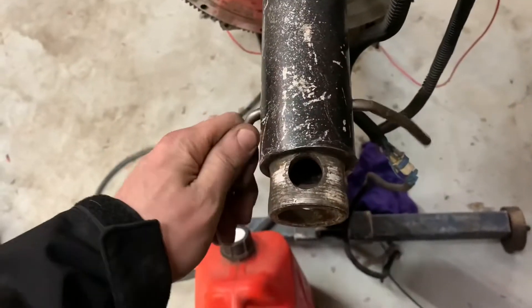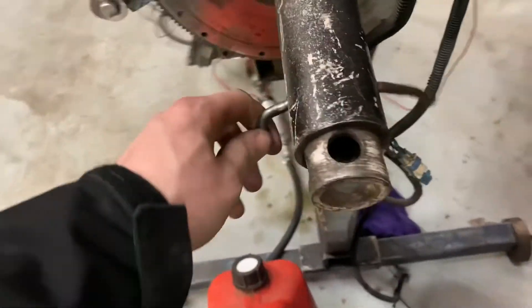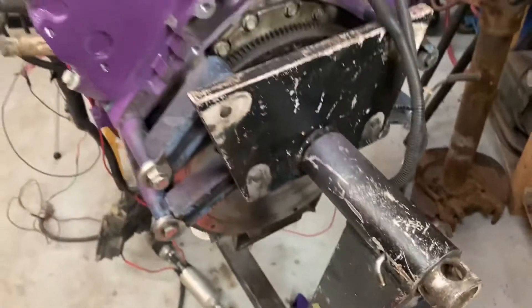So let's go put a tune in it, haul the PCM out of the Cadillac and plug into this, and let's try it again. We're pretty much ready to fire - PCM is plugged in, I just got to put gas hoses in the tank. I went ahead and put a push rod through here and bent a piece of it so it would stay in there, because yesterday I just tipped the engine over.